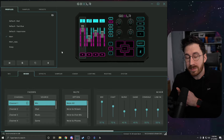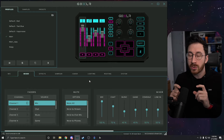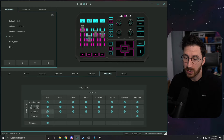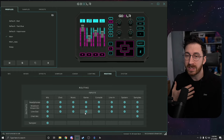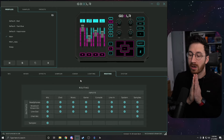All right, so now we're on the gaming PC. The first thing I'm going to go over is the GoXLR and how I have it routed. This routing table can also be achieved with other things like Voicemeeter — you can probably route it the same way, just look up a different guide for dual PC setup with Voicemeeter instead. So with the GoXLR, for the line out — this is everything going to your actual stream PC — I literally have everything checked off: sample, system, line in, all that stuff. So any alerts, Discord sounds, game sounds, or Streamer Bot audio cues will be captured and sent over to your stream PC.